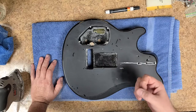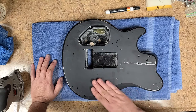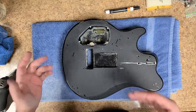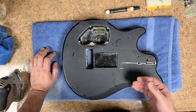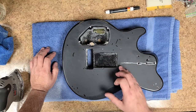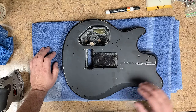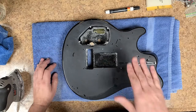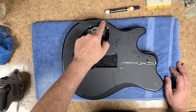What I'm going to do is fix all of the problem areas on this body. On the back there's really nothing that's a really bad low spot, but the scratches do create a low spot. So I'm building up those scratches with paint a little bit at a time - as the paint dries I'll fill it in again, bringing it up to the level of the clear coat. When I do the final sanding, you won't even see there was a divot where the scratches were.